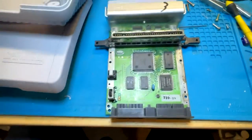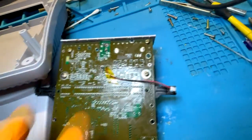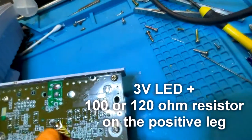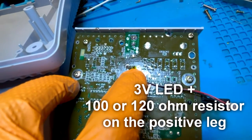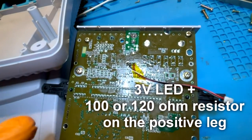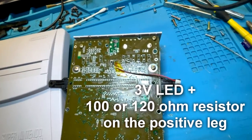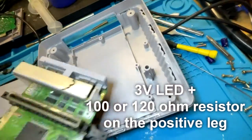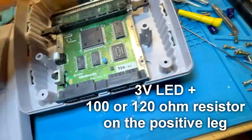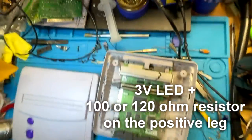I've got this thing pretty much wrapped up. The solder mask is dried and solid — that's good. I also set this up for an LED light coming straight from the voltage regulator. The ground is the middle pin and the 5-volt output is the far right when looking at it from this angle. It's on a breakaway cable — I prefer doing it that way so if I or somebody else opens it up, there's no desoldering or risk of ripping wires.